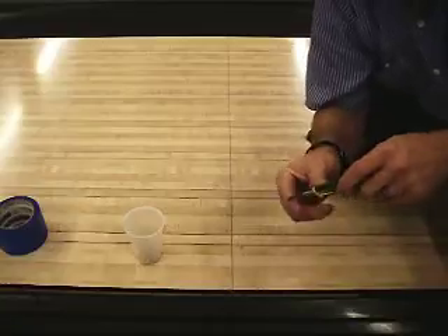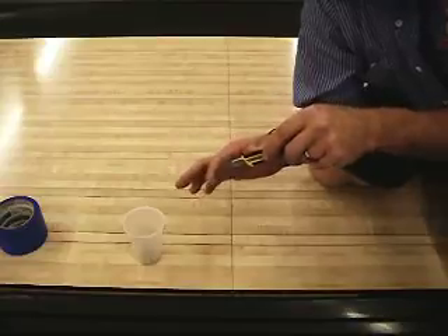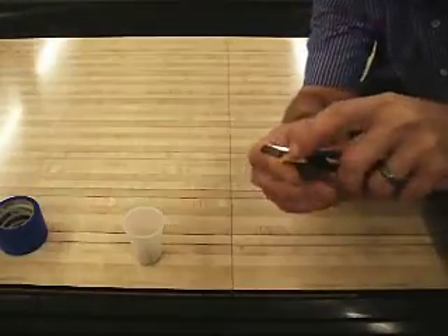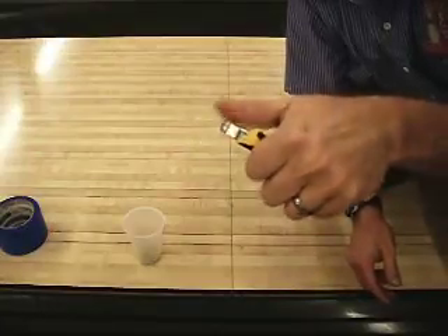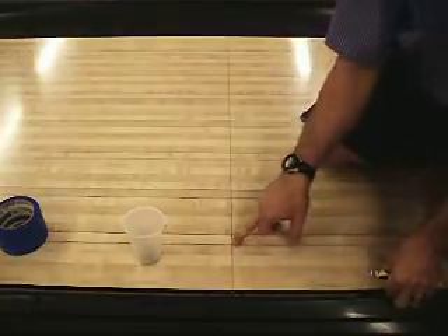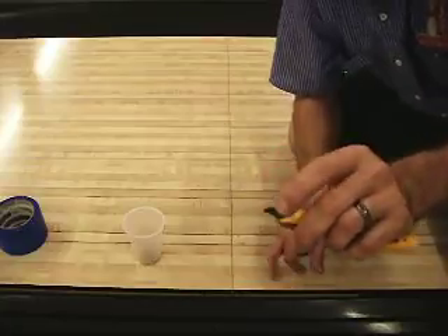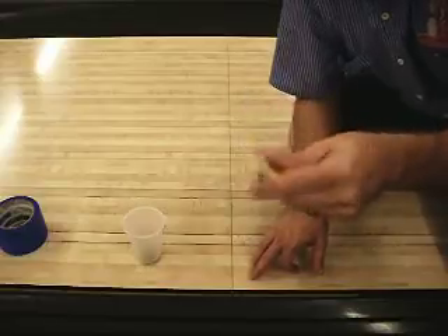The next thing I do when cleaning it out is use the front dull edge of this blade — basically as a plow — to dig it out of that trough and work it up. I'm lucky that the bottom edge of my razor knife here is rounded, not sharp, so I can run that across the panel without gouging it. If your blade doesn't have a rounded edge, be careful — as you press that sealant out, you may gouge into your lane with the blade itself.